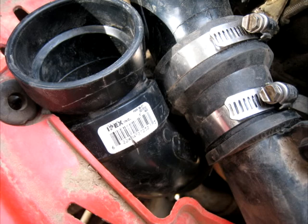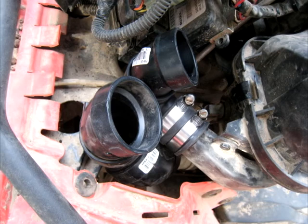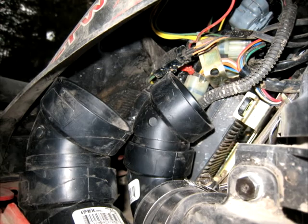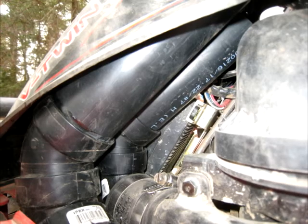Here's a photo of the point when I realized that both pipes being two-inch are not going to fit — the cowling of the pod will not fit over top. At this point I'm changing the pipe work to the air box intake to the proper size. In the foreground you see an inch and a half straight rubber coupling; in the background I've got an inch and a half tight Street 90 and an inch and a half 45. Working up towards the instrument cluster pod you've got a two-inch Street 45 and an inch and a half Street 45, a couple of short pieces of pipe — and voila, the intake part is done.